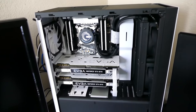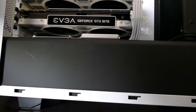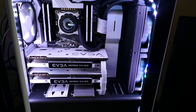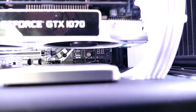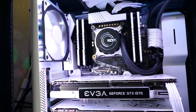Walter White is having a few issues - maybe just one big issue. It's not posting at all. Everything's turning on - that's a fan scraping against something on that graphics card, I'll have to fix that. Right, everything looks like it should be running, but if you check down here there's a Dr. Debug right back there, and Dr. Debug is not showing any code whatsoever, which leads me to believe there's some kind of power delivery issue, or that the CPU is not seated correctly - maybe a bent pin or two.